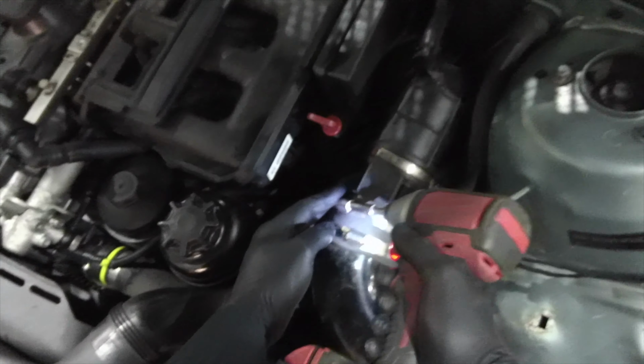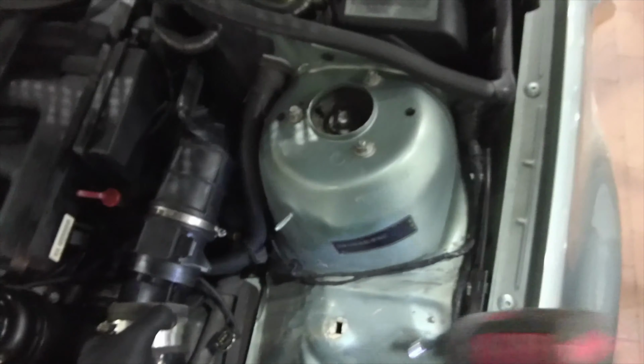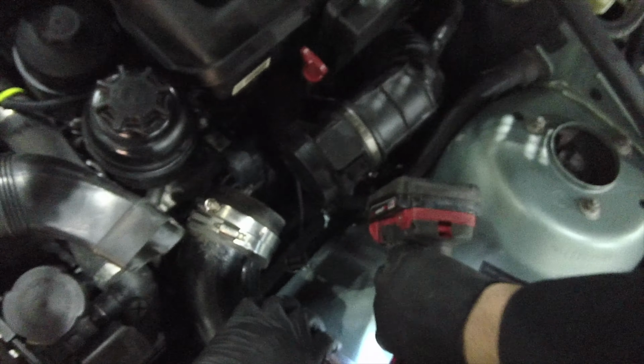Installing one of the new vacuum plugs onto the port of the intake manifold, which they are different sizes and may have 2 to 3 ports behind the manifold. Removing the intake and intake boots to inspect one of the vacuum lines that lead to the muffler exhaust flap.